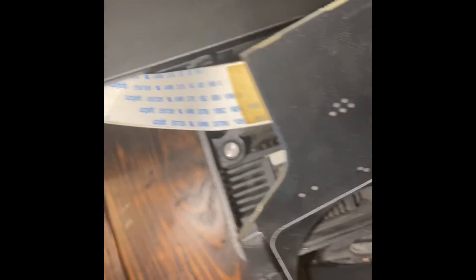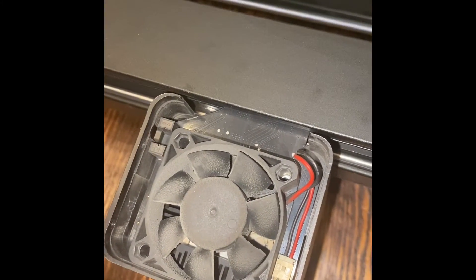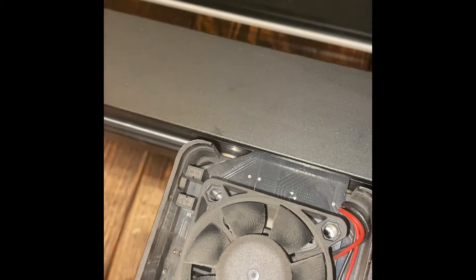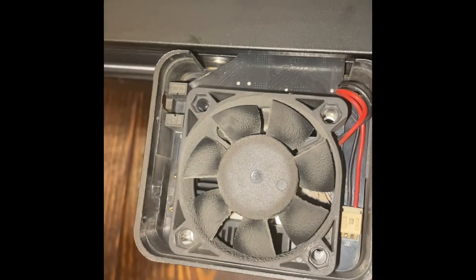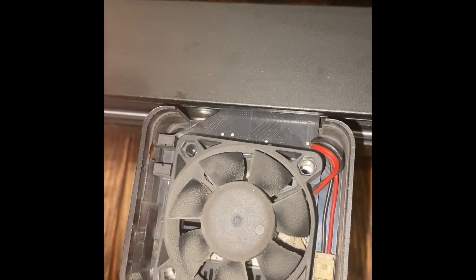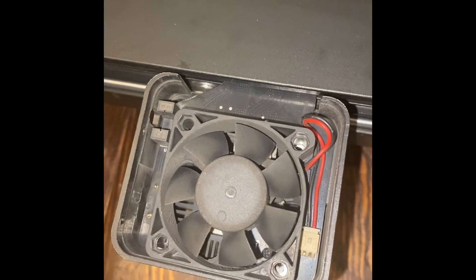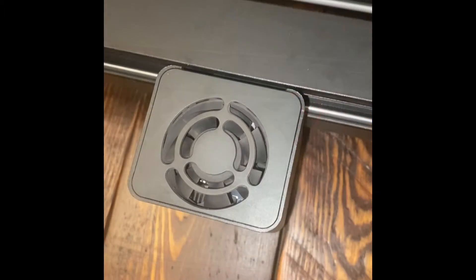Be careful with your ribbon wires. Once you get the board back in, be very gentle with the ribbon wires. If you have to use a Q-tip to help guide the ribbon wire back into the groove that it comes out of, use a Q-tip — I wouldn't use a metal screwdriver. Also remember, we're going to clean this fan here in just a second. There's a right way and a wrong way to put this fan in — on mine the sticker goes down. If you do put the fan in wrong, it will not circulate correctly. To clean the fan, use the Q-tip or the toothbrush, whichever works best depending on how much buildup you have on there. Once you get the three fan screws in, put your four screws in that hold the top plate on, and then that's it.